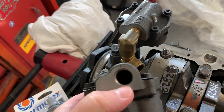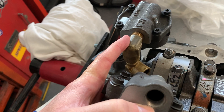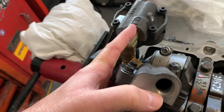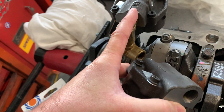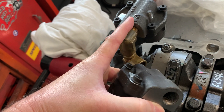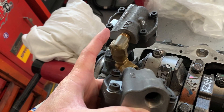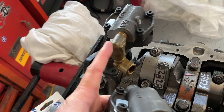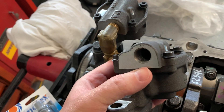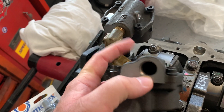You need to pay very close attention because with a remote sump pickup, the original pump had a tapped hole in the bottom cover of the pump for the fittings, and the pumps you buy now don't have that — they are not tapped for this. This pump has a 5/8" smooth inlet versus a 3/4" inlet. If you buy a pump with a 3/4" inlet, it will be too big to tap for what I believe is a half-inch MPT. So these are the original fittings from the 283 remote sump pickup system, and I let my machine shop tap the bottom cover for the appropriate pipe thread.